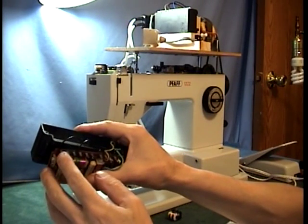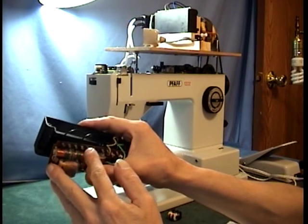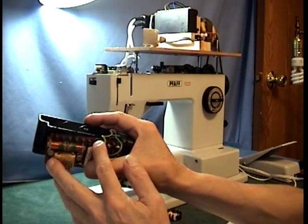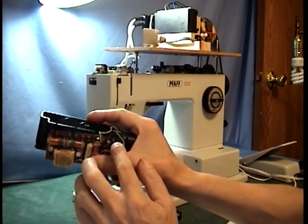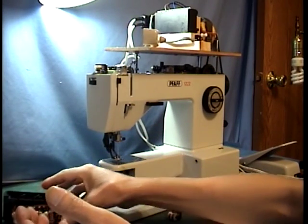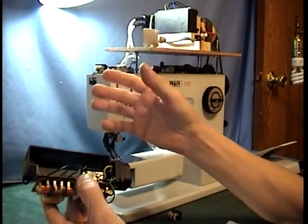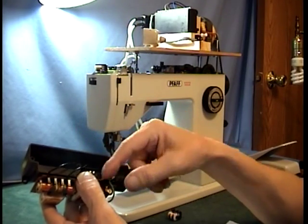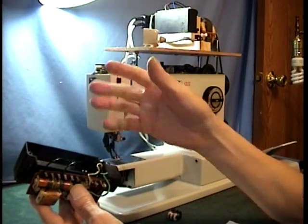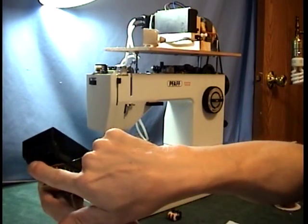Your light is on pins one and three, your motor is on pins two, four, five, and six, and your Stopmatic switch is on pins seven, eight, and nine. You can take a picture of how it's wired, so when you get the board back you just look at the picture and put the wires right back on — it's very easy.